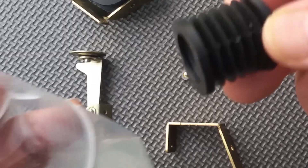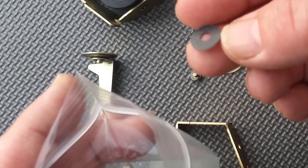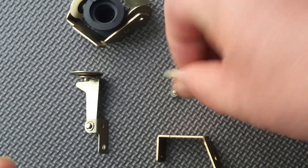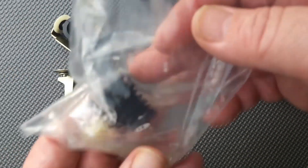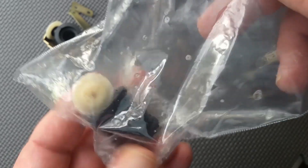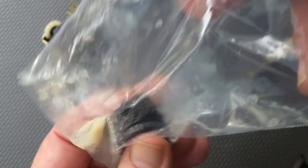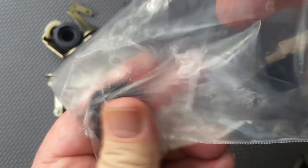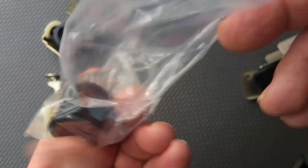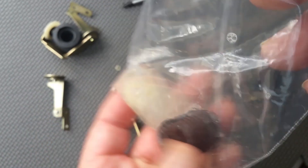Let's give it a wash. These are oily inside — you can just see the sheen on the washer there. Perhaps some previous owner thought a little oil would help the machine work better, but no. The oil on the bellows is probably going to make it come off or just not operate properly. You can actually see in the water it's got a slight film color to it. There's a drop of dishwashing soap and some warm water.